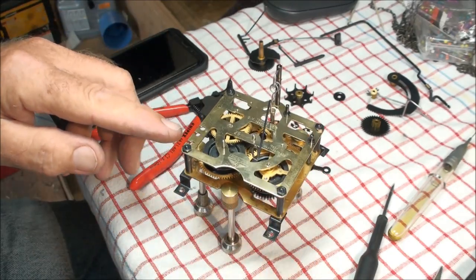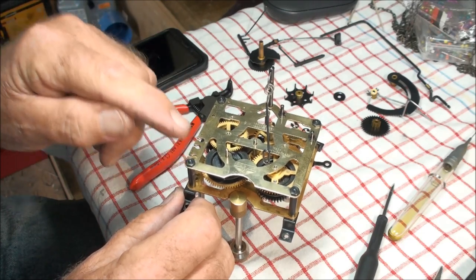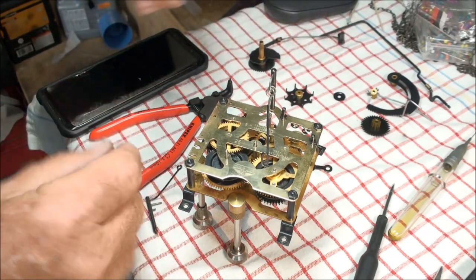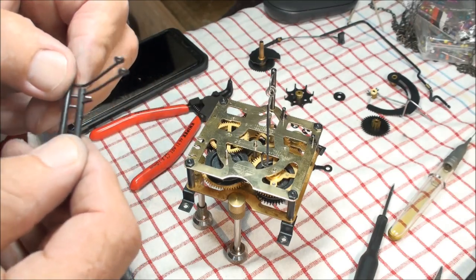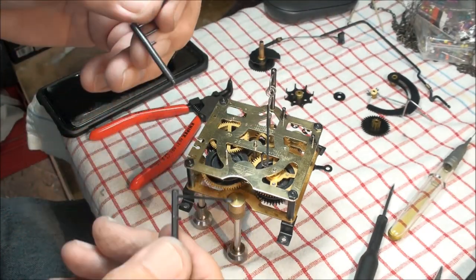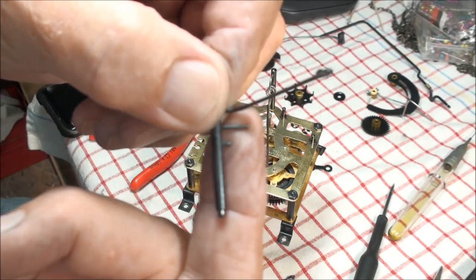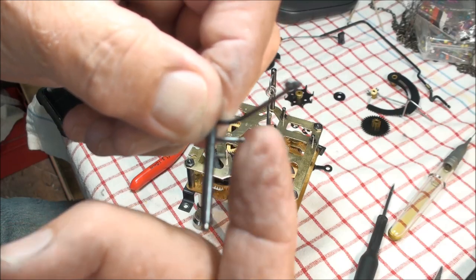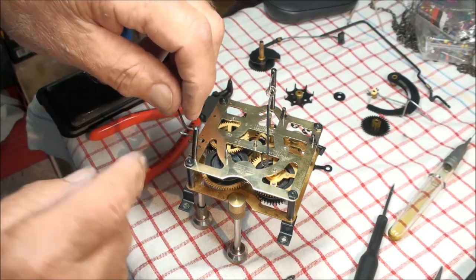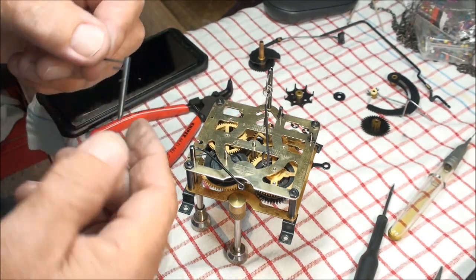So the way this thing came apart is you have to put the lift arm on first, then the hammer. And if you looked at your pictures or did take pictures, the longer lift arm for the bellow goes on first. The small little rod is the lock to hold this in. This one here is the one that hits the star wheel. Just pop that in, get that little one to go through into the plate. On. Same with this one.